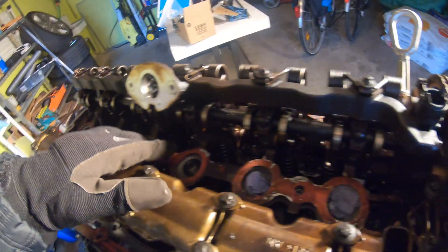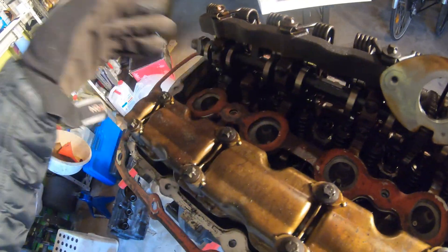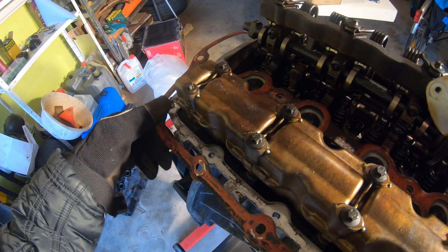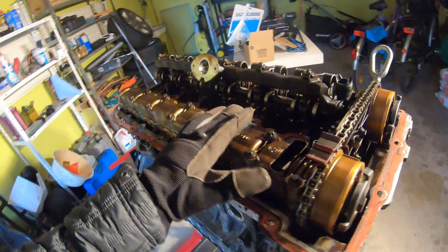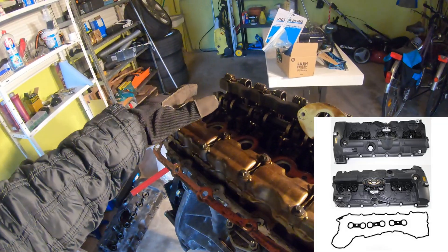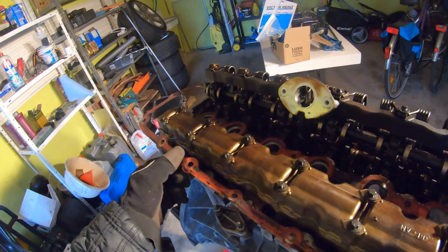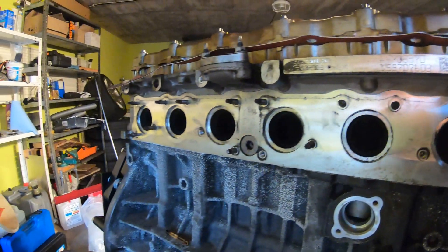I have the magnesium valve cover, which comes in two parts. What you need to watch out for is that this gasket can get pinched if it's not on the dowels correctly, or it can shift at the back and pinch the gasket, causing a leak. If you have the blacktop M52, it has a rubber gasket and the same thing applies — at the back, as you're shifting it around, you can bend the gasket and it won't seal properly.